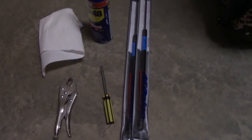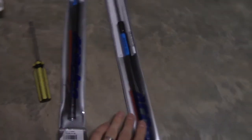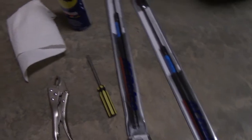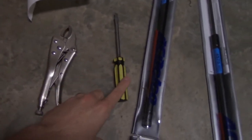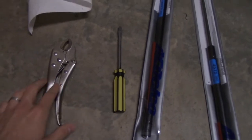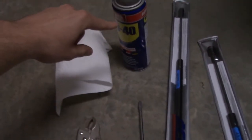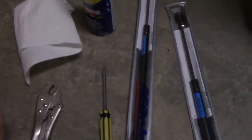The issue is your back lift support for the window. That's this part right here. I bought the AC Delco parts — that's what I usually try to go for if I can get that. For tools, this is pretty simple: you just need a flathead screwdriver and some vice grips. I also have a little bit of WD-40 and a rag to oil up the joints.